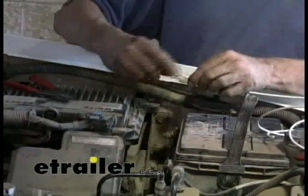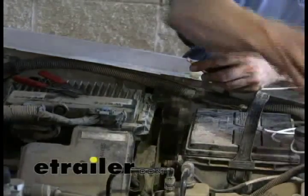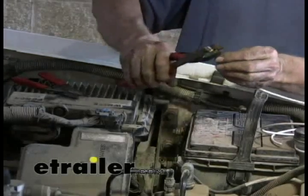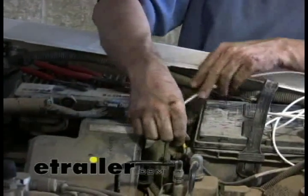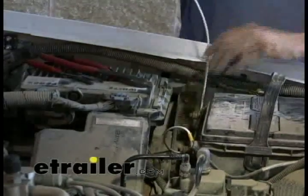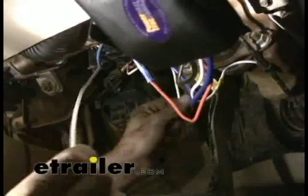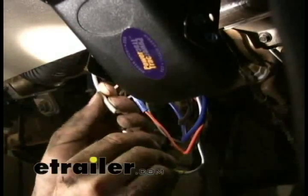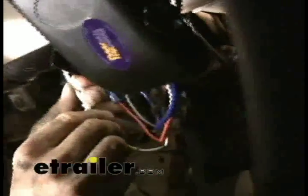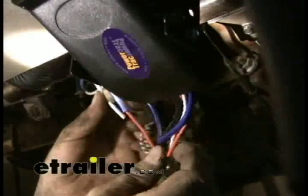Now it's just a simple matter of running our wire — our ground wire — all the way up into the cab. Then we'll make a jumper from the positive terminal to the side labeled 'battery' on the circuit breaker, and then from the other post back down to the brake controller. Make sure it's good and tight, and we'll run that along the side here and back through the firewall. We're doing this one wire at a time. The reason is to make sure you connect your ground wire to the ground wire on your brake controller — if you accidentally run these two together, you'll instantly fry the brake controller and basically brick it.